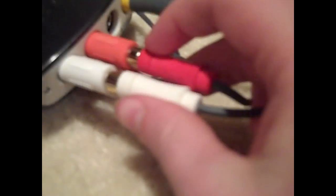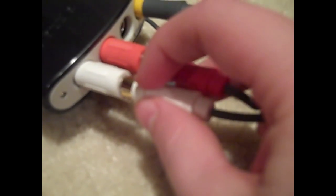Once you've got the cables inserted, it should look something like this — the Turtle Beaches adapters in first, followed by the adapters of the Dazzle, and then this goes in by itself. Then plug the end of the USB port into one of your Xbox USB ports.